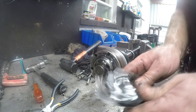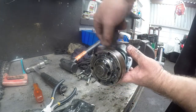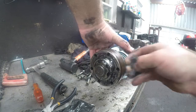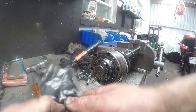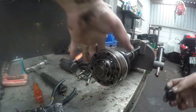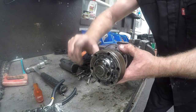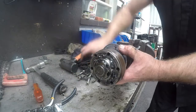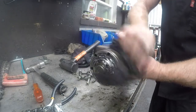We will just grease up this inner CV joint between the flanges — just stick the grease nicely in the back there. You can see the grease basically sticking through. Centrifugal force will obviously push this grease outward and lubricate the complete joint as you drive along. The main thing is to get the grease in there. Once the grease is nicely in, you can see it is pushing out nicely, lubricating the whole joint. It is a messy job with no clean way of doing it.